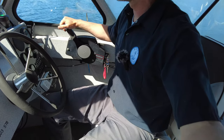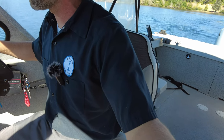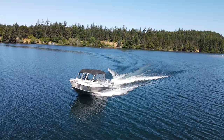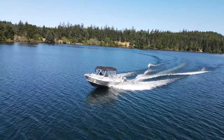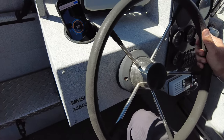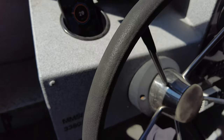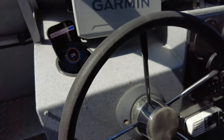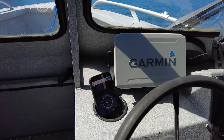Let's go for a straight hole shot. Boat's just in gear — we're going to see how it does trimmed all the way down at 1,000 RPMs and then full throttle. Climbing up, trimming up, bringing the trim up some more — 27, 28... 6,000 RPMs — 29. There we go, we're going to get 30. Put the trim down a little bit, we're starting to hop. That's going to force the nose down — settle down. I had the trim up a little too high for the boat.